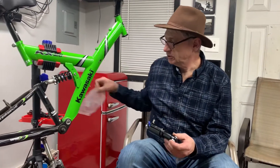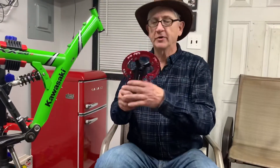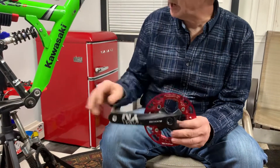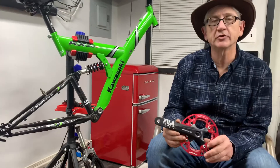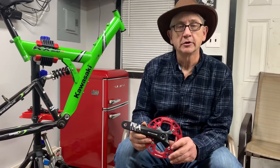Because it's a little bit longer I think the bike will just come up a little bit overall. Since it's an air shock we can adjust sag in the rear and in the front, so with the rider sitting on it, it should sit at about the same height. Now here's my one-by drivetrain — I ordered a 113 millimeter bottom bracket, so I should have the right chain centerline, about 50 millimeters, when I put all this stuff together.